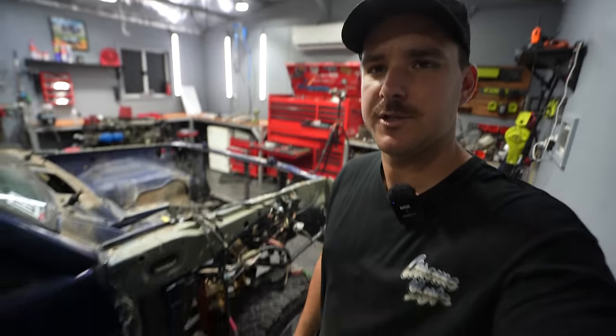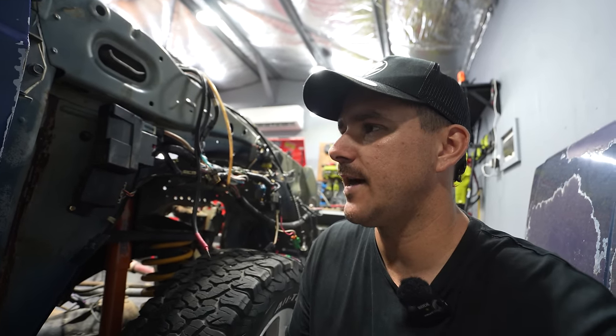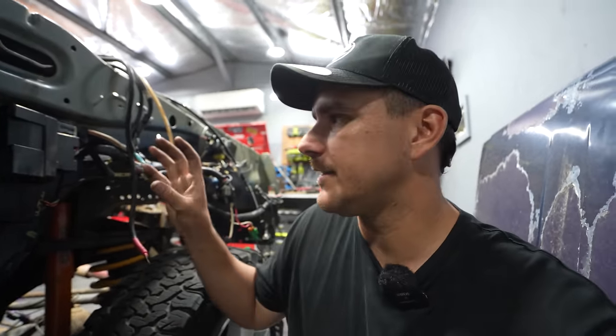Now, there was just a little bit of a concern in the comments section on the last episode about the relay boxes being in the fender arch, and I'm going to address some of my thoughts just so you guys know where I'm sitting with this. Now, the main concern that everyone had was water and dirt getting up in here. Now, this does actually have an inner wheel arch liner. So as I'm driving in the mud, it's going to be flicking up, it's going to be hitting that liner. There won't be any mud getting around these connections at all.